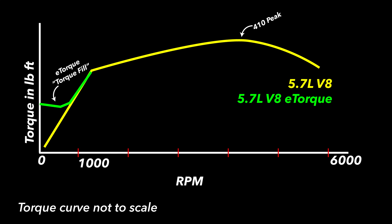In the 5.7-liter Hemi, the 410 pound-foot maximum happens when the engine alone reaches 3,950 RPM, and by that time the motor has stopped assisting. However, from 0 RPM to about 1,500 RPM, the torque curve is altered — we actually produce more torque than the Hemi would on its own, because we get that 130 pound-feet almost from 0 RPM up to when the engine takes over. The motor can also expand the time the engine spends in fuel cut-off mode while decelerating and in cylinder deactivation mode, by adding a little torque at those low RPMs when needed.